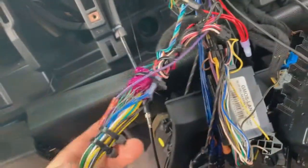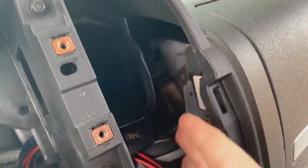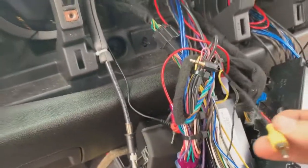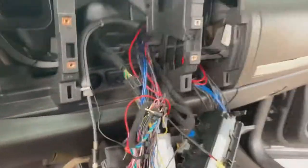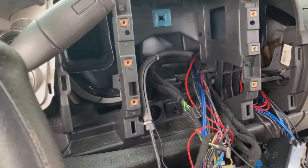This is what we're working with right now. We got all the RCAs down here grouped up how they're supposed to be. We got the harness fixed, looks better. Got the remote wire right here, all the ignition wires tapped in. We have all these extra RCAs, so I ran them over here — we have all the space back here, so once we get the radio in there we'll be able to tie up all the slack, zip tie it and tuck it in there. We have the new dash kit on. It's all hidden, you don't see nothing. You got the USB dropped in here, we got the mic, we got the antenna, we got the RCAs, we got the backup camera. Now it's time to start plugging away — the hardest part of this install is getting all this to fit back there.